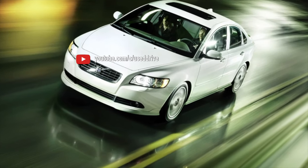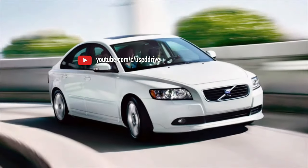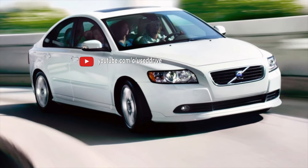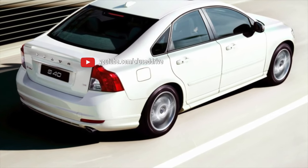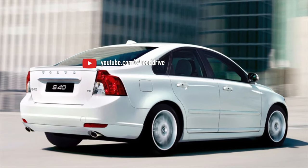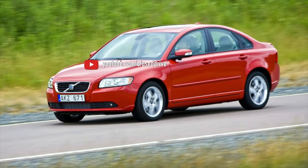The situation with engines is quite simple. Almost all gasoline engines here are of a modular series, but a rather rare 4-cylinder variety. These are found only in the first S40 or early 850. Even the 6-cylinder versions were produced longer, not to mention the 5-cylinder. The design of the 4-, 5-, and 6-cylinder engines is unified, which makes it possible to find spare parts for even a very rare engine, since its components are found on more common cars.